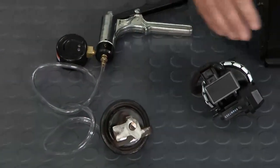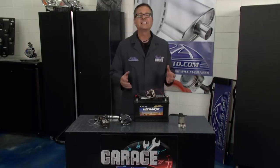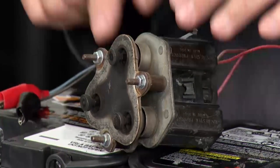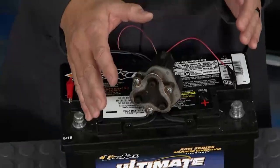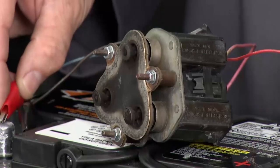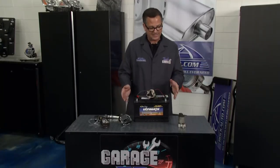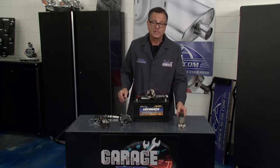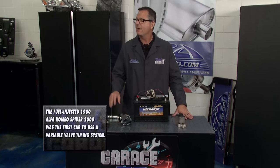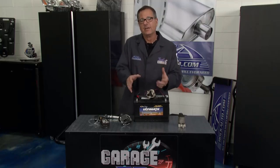Ford likes to incorporate everything into one unit — vacuum actuated with the pressure valve and solenoid all integrated. From there we went to the digital EGR, which has three solenoids: 33%, 66%, 99%. It can open one at a time to let a little or a lot of EGR flow in. Then we went to the linear EGR, which could go in steps — 1%, 2% — very accurate. Once we got that precise, we moved without it entirely. That's what variable valve timing does on an engine like this M45 — it varies the camshafts and holds that exhaust gas in the cylinder to reduce NOx.